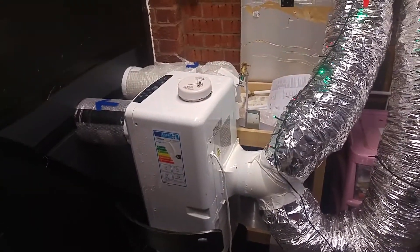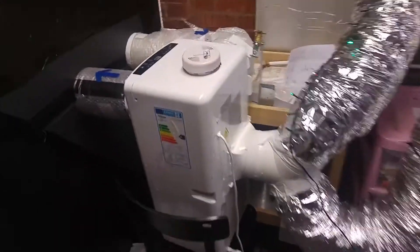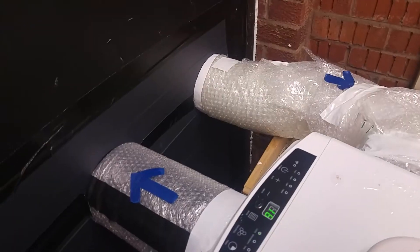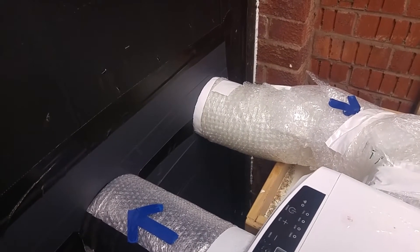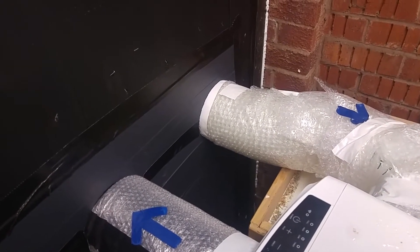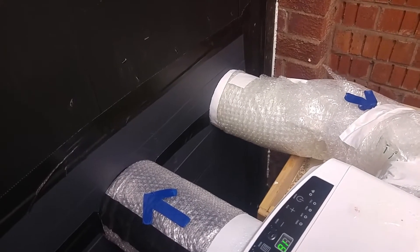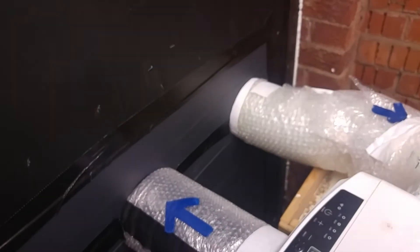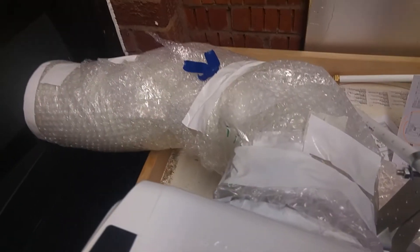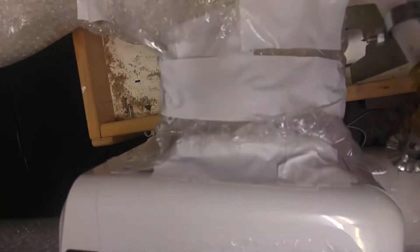An important feature to get good heating or cooling in an air conditioner heat pump is the dual hose. In the instructions it will show you to put one hose out the window, but this is inefficient as it blows conditioned air out the house and causes outside air to leak in. To run these efficiently you need a second duct to outside to return to the inlet.